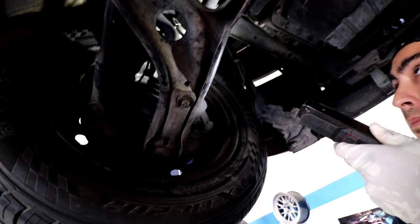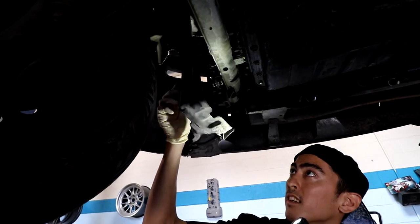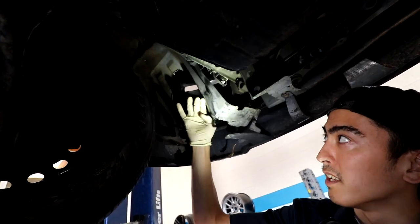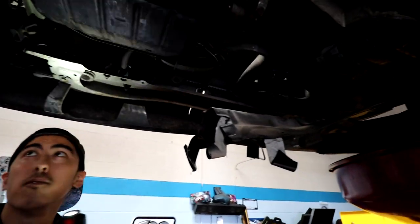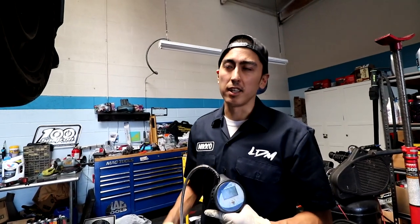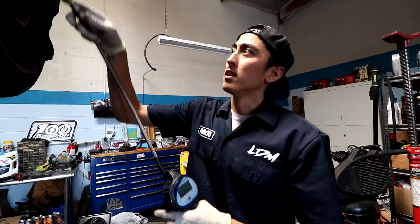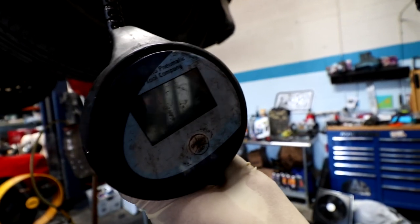As you can see here too, this fender liner is coming apart. If we were at the dealership, anytime you see something like this, you're going to recommend the whole fender liner — we don't recommend just zip tying it. This one would have recommended that as well as the passenger side, because both are coming apart. Another thing you need to check on every car — state law now — is tire pressure. The tire pressure spec is usually on the door sill. That's something you could be doing while the oil is draining: just walk around and set the PSI on all of them.